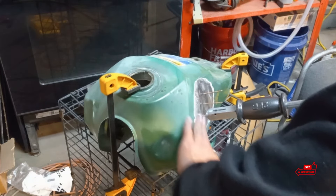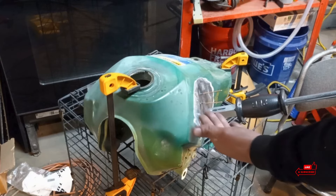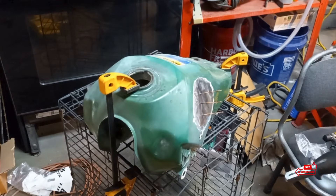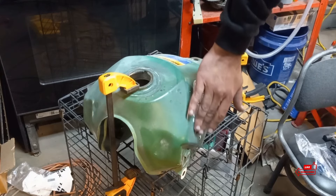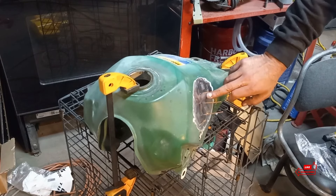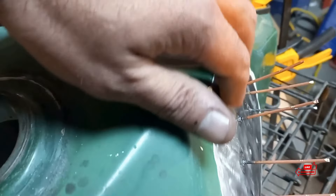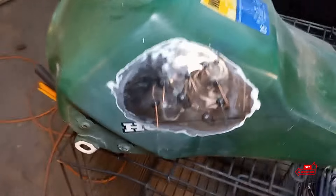That's already coming right back to where it's supposed to be. Metal kind of has a memory to it — you could stretch it, and then it'll be too much metal for it to go back to its original shape. Therefore you'd want to leave it a little lower than where it should be, then do your body work from there. That one came off nice and easy. This whole section here is starting to really come around. I'll go over here, continue doing what I'm doing, then I'll pick back up and show you guys where we land.